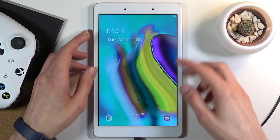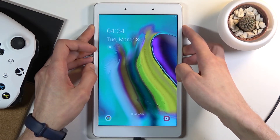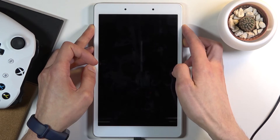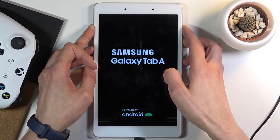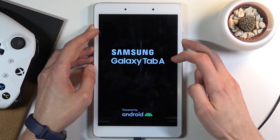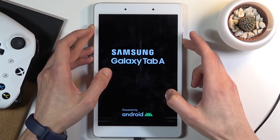So now let's try it: volume down and power key. It will capture a screenshot — don't worry about that. Keep holding. Once the screen turns off, switch to volume up and power key. When you see the Samsung logo, let go of the power key. As you can see it turned off because I held it a little bit too long — just keep holding until you see the logo again and then let go.